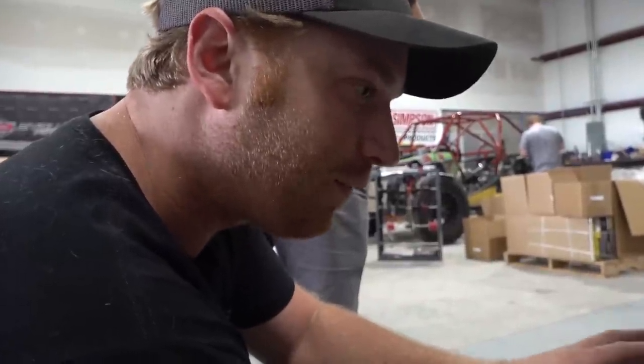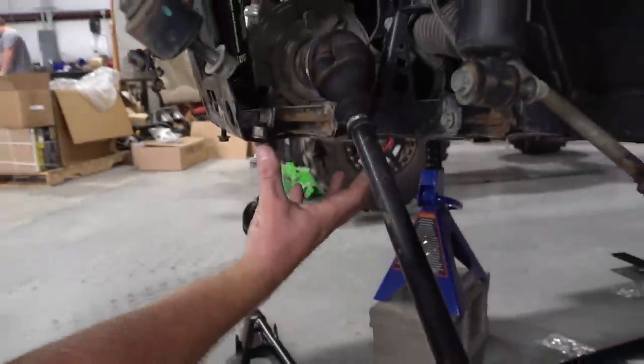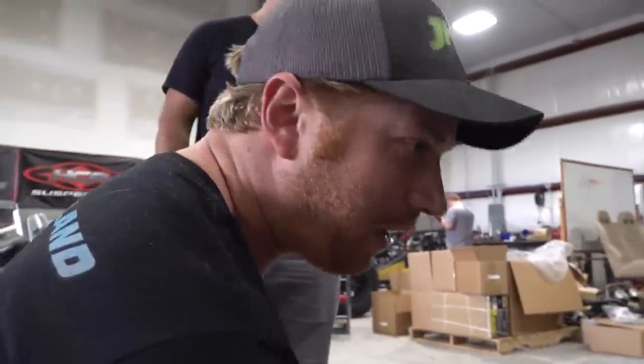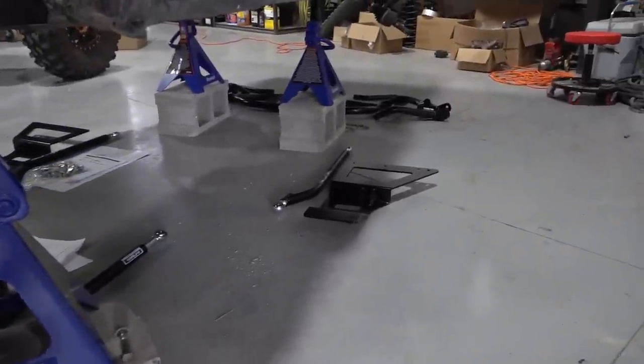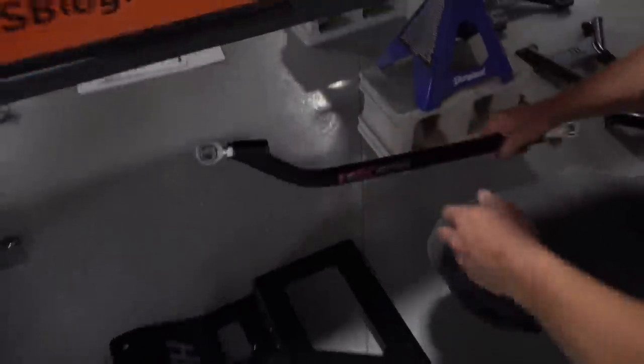basically suspension and frame stuff, let me look at all of these support pieces. So this is a frame brace that ties in all the lower A-arm mounts. So basically a gusset just to toughen everything up. And then back here, these plates, that one that's sitting in the center, those two big plates that are sitting towards the back, those bolt to the bottom of the chassis and are the mounts for these link arms. So on all four corners, we'll have these link arms. Wait, four corners? Yeah, front and rear.